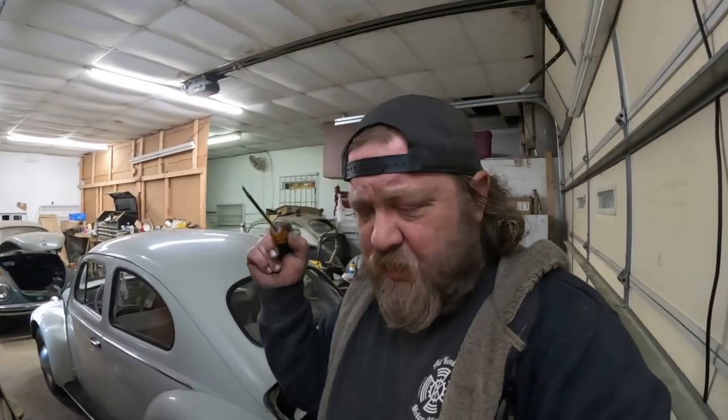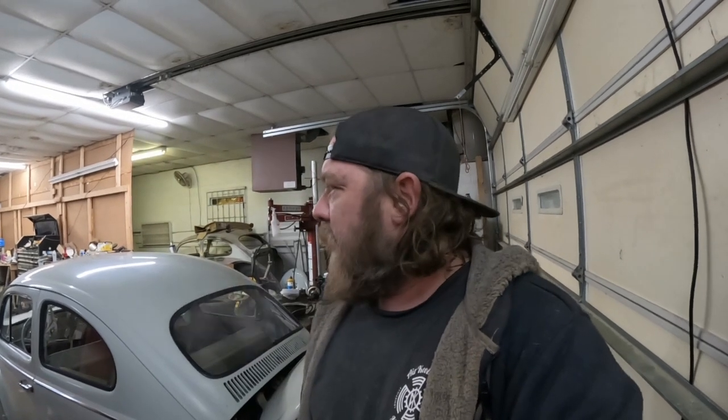It was cutting air, shutting the thing down, so you know the carb was at least dialed in correctly. Because when that thing shuts, your car should die. If it doesn't, and that valve shuts, that means your throttle blade's open. So, with that said, I think I'll get on a big cam and wrap this thing up because it's done. I gotta put a rear view mirror on. Other than that, it's pretty much wrapped up.